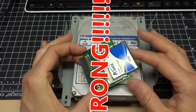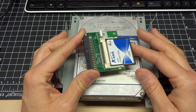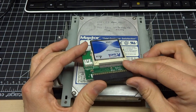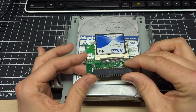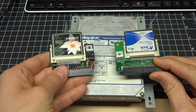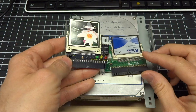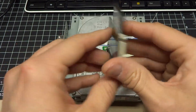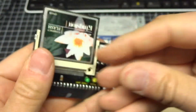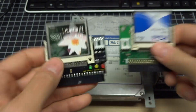So I went out and bought this compact flash to IDE adapter. This particular one runs everything at 5 volts, and yet it did not work — it froze up. So right away that shows it was not a voltage issue. Incidentally, I had also bought a second adapter, a different one that has a jumper allowing you to pick 5 volts or 3.3 volts. But neither of these worked.